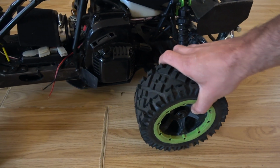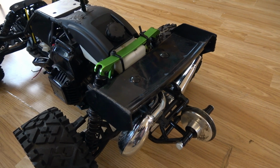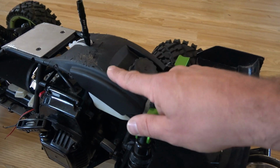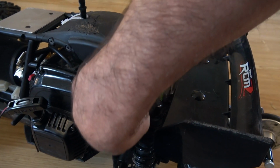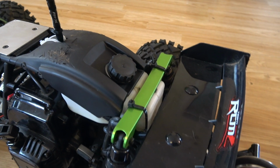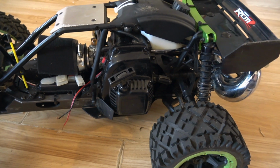And also changing the tank breather. You can see the tank there. It's very small. And yeah, I did actually have a bit of a leak from the tank, which was a bit annoying. There's a grommet at the front where the pipes come out. And I did have to fit a different air breather to the tank because mine didn't seem to function, and I did actually have a bit of engine trouble as a result of that when I first got the car.